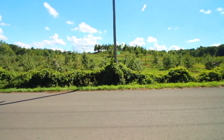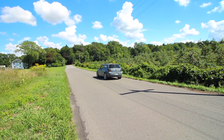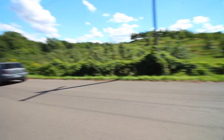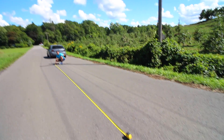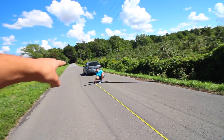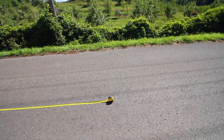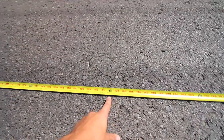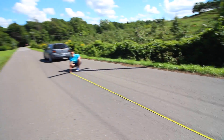I've got the measuring tape right here. He's coming down the hill at 60 kilometers an hour and stopping as soon as he passes the telephone pole. You can hear the ABS just like yesterday. We're going to see if the distance from the front of the car to the telephone pole is any shorter. Already we can tell there's a huge improvement from before. Where my brother is right now is the 25-foot mark, so from 25 to here that's 50. That's where the car stopped before for the last try, but it's down to 16. So 25 plus 16 - that's 41 feet. That is a lot better than before - a huge difference.